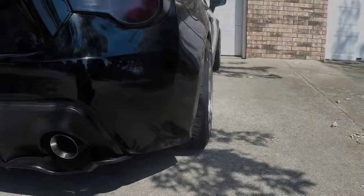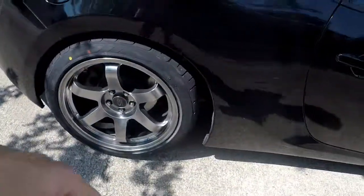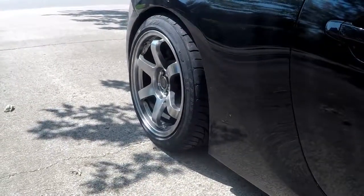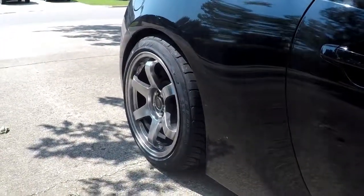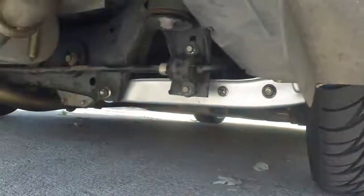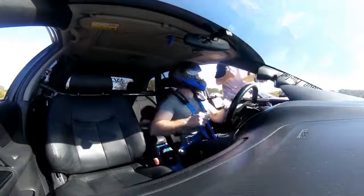As you can see, we've got enough camber out now where the tires almost stand straight up, which is where we wanted to be, and we're not scrubbing tire too badly. Overall we're in a lot better shape than we were — it's just a shame those LCAs didn't adjust plus or minus two and a half degrees like the claims stated. We're going to be getting probably some Megan Racing or similar mid-range adjustable LCAs — not some no-name brand off eBay — where we can get some real adjustability. Hopefully we won't destroy this new pair of tires too quickly.